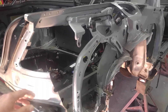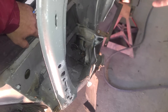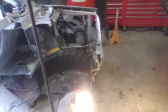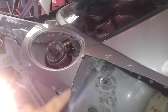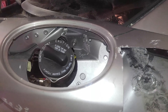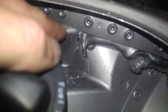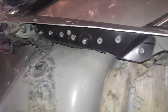Right now, all of this crushed area will have to be cut out, roughly around here somewhere. The clip section is meant to go there. The mechanism will probably need to be replaced. Without taking the glass out, they're going to cut it right at those reference points and do a little bit of welding here and here with some bodywork. It's tricky because the glass could get broken, which would be more of an expense. It's also riveted over there with bolts that go through — it's a complicated spot.